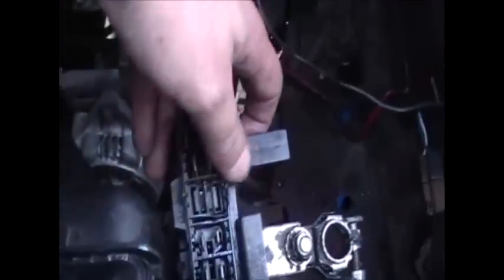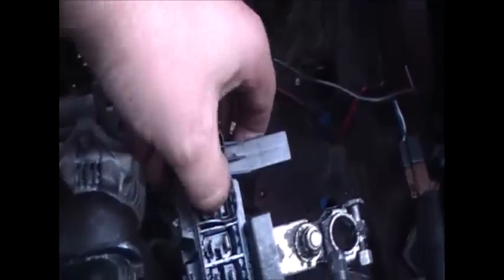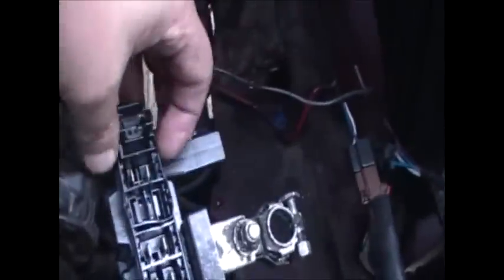Alright, there's a fuse on here, 100 amp fuse, and the other fuse, you can see how they just come off the pins there. Now this other 100 amp fuse, I thought it was just stubborn, I thought it had corrosion or something on it. Didn't experience this type of fuse before. It actually unbolts from the sides. So you've got to undo those bolts first,